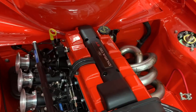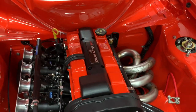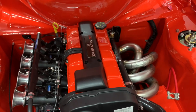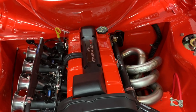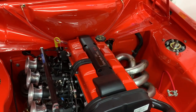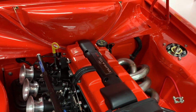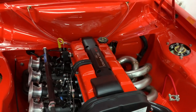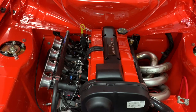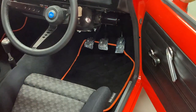And you'll probably notice there that the cam cover has reacted again. This is the second time it's happened. It's because the cam cover is made of magnesium, and I've now had it professionally painted twice, and it starts reacting after a number of months, or in this case, I think it was weeks. I don't know what I'm going to do with that for now. I'm just going to live with it, but it is something I need to address at a later date. Anyways, let's crack on with some of them little jobs. Now, here's something people will really be glad to see the back of.